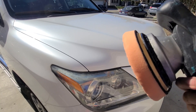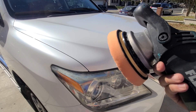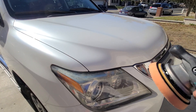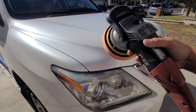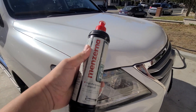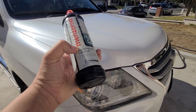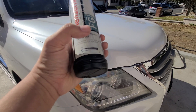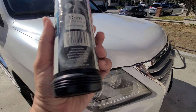Make sure you get a proper pad and clean pads. I'll be using this Flex polisher to correct the scratches and inconsistency in the clear coat. Not only that, it also preps it up for a sealant. I'll be using a dual action polisher, an orange polishing pad, and this Menzerna Fast Gloss — I've had this for a while and it's gone a long way. It's a high performance compound, a one-step polish that removes sand marks up to 1200 grit, so that's what I need — nothing too hard.